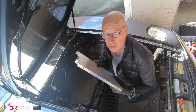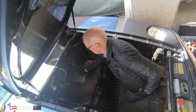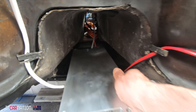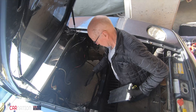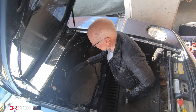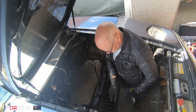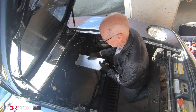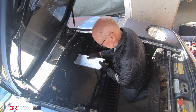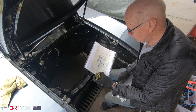You might think: why not put two batteries in the tunnel? They don't fit. This cooling plate is for one battery and we need 18 of them. Because they're in pairs and quads, one battery sitting back there doesn't help. Also, that area is needed for the battery management system from the existing battery pack. So the layout is four, four, four, four plus two on top - not quite all the way back. This design was called Herman, so the new one will be called Adolf.